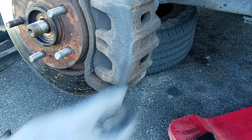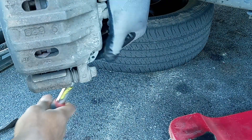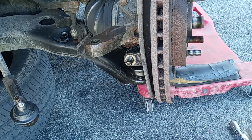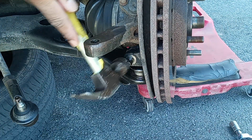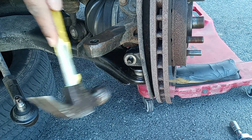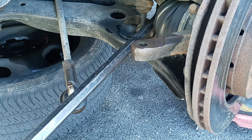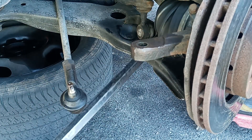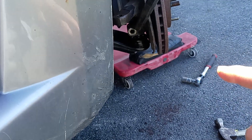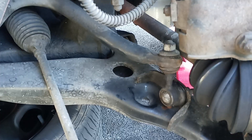You also want to turn to the other side to take out the next nut. Use a hammer and knock it out like this — easy, but don't knock it too hard, you don't want to spoil the arm screw. After that, use a crowbar and pry it out until the spindle comes right out. Put the crowbar right underneath the spindle and between the lower control arm, and just pry it out.